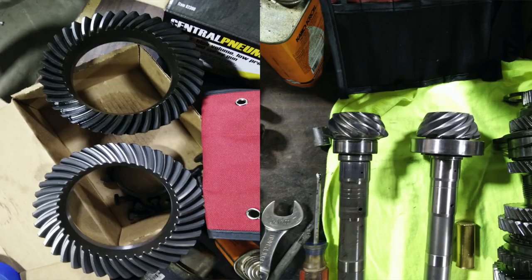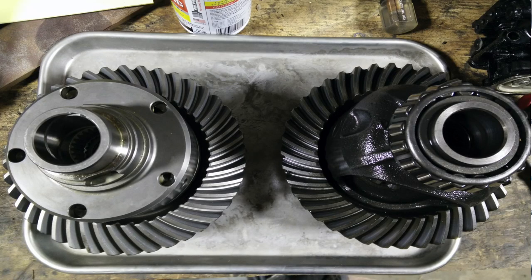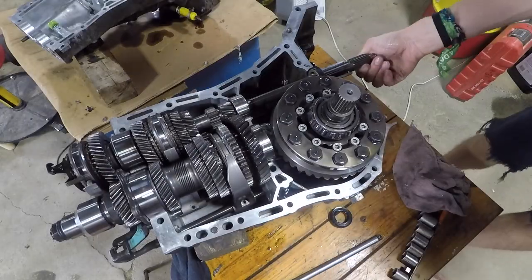There's a kit that a company called Subaru Gears makes, and they make this kit with reverse cut ring and pinion gears. So you can take a Subaru five-speed transmission, split the cases on it, tear it in half, replace the output shaft, replace the gear on the differential, and flip it, put it together — and it goes the right way when it's in a rear-engined vehicle.